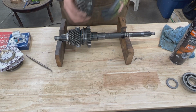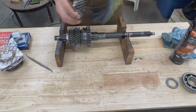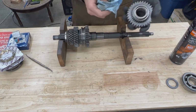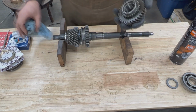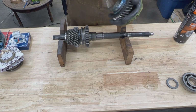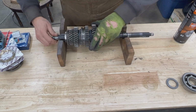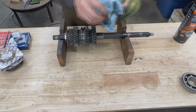You see how I leave the cleaning part for last. I don't clean all my parts together and then at the end just assemble them. The glue, the grease and everything is attracting dust. If they sit for 2-3 days here on the bench after they've been cleaned, they're going to get contaminated again. So I'm cleaning them just as I am assembling them. So now it goes on top of its bushing again in this direction. That's it. We have another adjuster washer here.